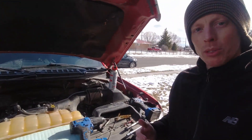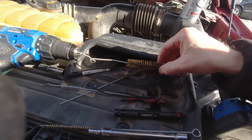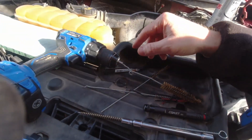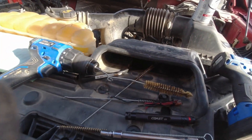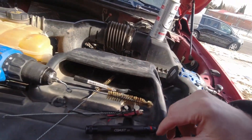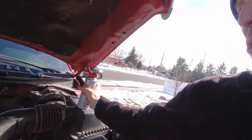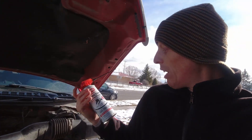I'm sticking down anything I can get into those holes — there's really not a whole lot of room. I got some brushes from Harbor Freight; they come with a little loop on the end that I snipped off and was able to stick in my drill so I can spin it down there. I've tried a bigger brush but it's too big to fit. I've even had to use a little pick. In between I have some valve cleaner that I'm spraying on there, which helps a little bit. I'm not getting them quite as clean as I'd like. You can do walnut blasting — you can get the blaster at Harbor Freight for about 25 or 30 bucks.